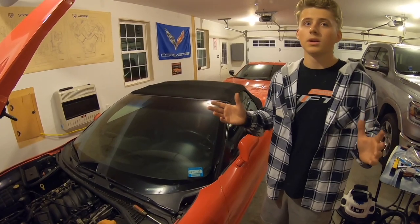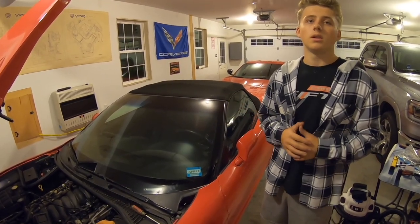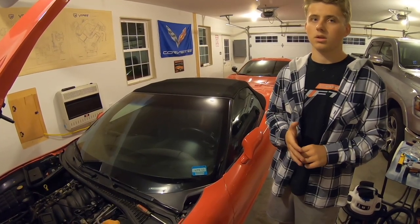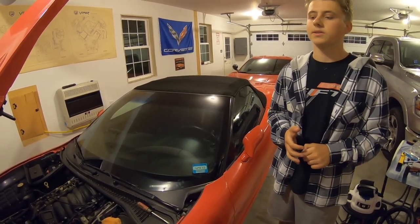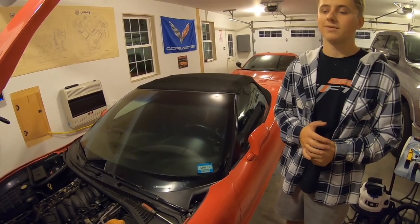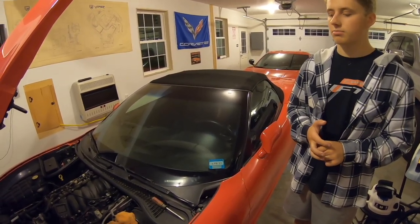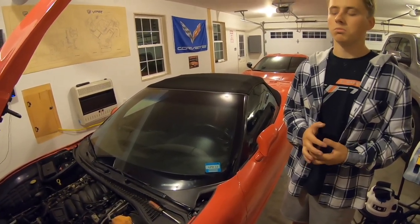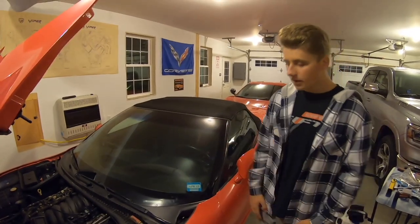And the hardest part of the project was not even getting the fuel rail off or anything. The hardest part is actually getting that clip off. Yeah. That took the most time. And actually putting the clip back on in the right orientation. Safely. Like, not breaking the clip or anything. Yeah. So getting the socket in and out, not too bad, right? No. It just had to pull a little thing back. Yeah.